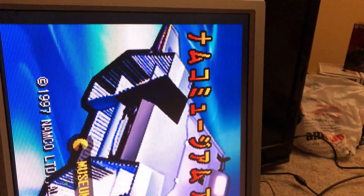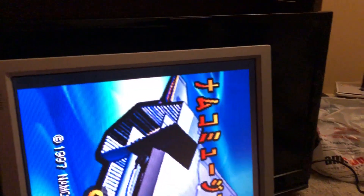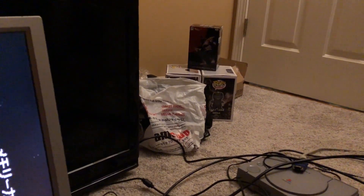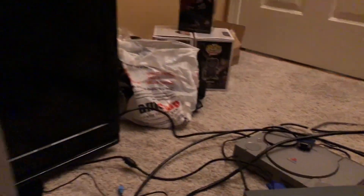I figured I would get this out since I did a video on the Dynex behind it the other day. Typically on this channel we demo and review CRT monitors, but why not do a few LCD monitors as well? Like I said, even with these devices the quality is not going to be quite as good as with a 15 kilohertz CRT running S-Video or RGB component, and also not as good as a 31 kilohertz CRT with an RGB unit, but it's actually still quite a fine substitute — it looks pretty good.